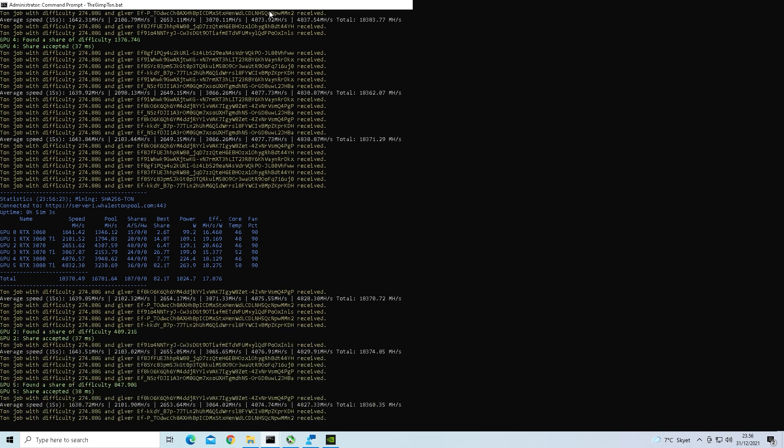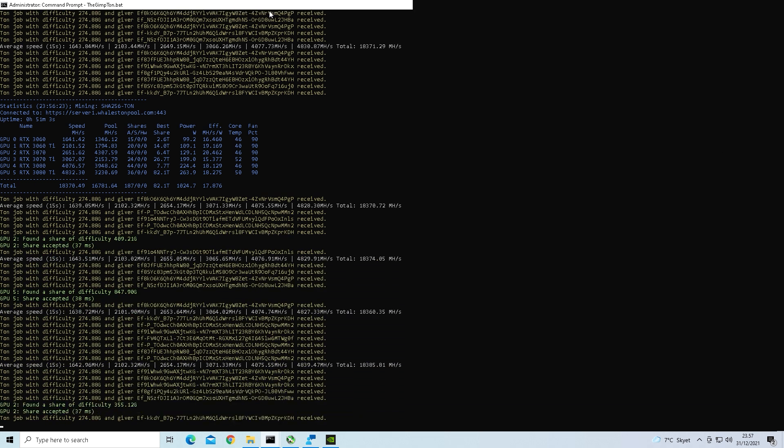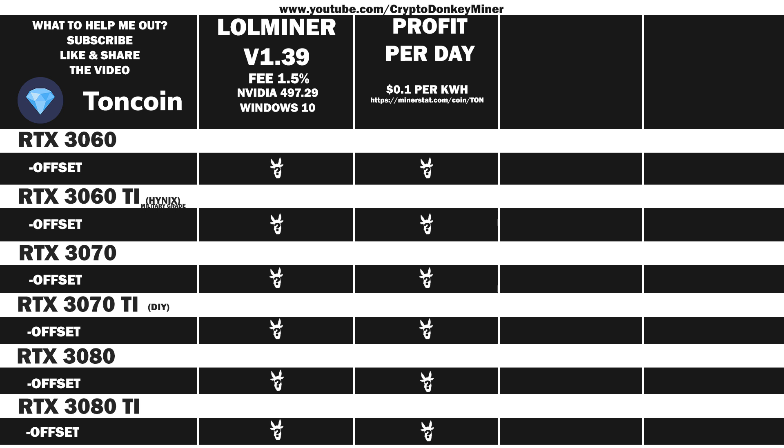It's time to have a look at the average results and the profits. Please note that all my overclock settings are highly aggressive and you can easily lower the core clock and still get a very good result. If you have heat problems, you can change the power level to something lower — try about 10 watts lower and continue adjusting downwards until you have a temperature you can live with.